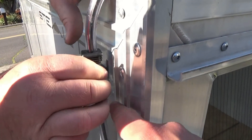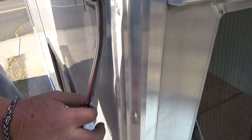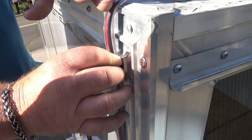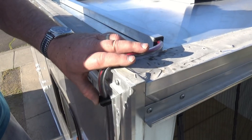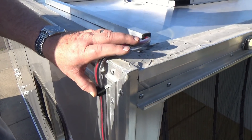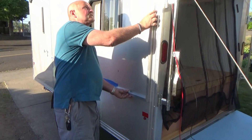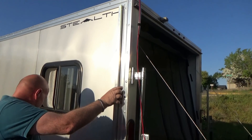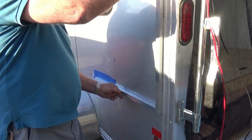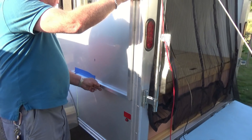On this end I got caps for the tube and put the wire in clear tubing — because of the hump here and the trim piece it wouldn't rise up and make the bend — so this is how I'm going to cap it off. Run that tubing in your aluminum chase, five or six inches. It makes a nice clean water-resistant installation. On the tube going down the side, I drilled a couple of weep holes just in case we get water in there. This is the wire chase coming down the side, and we'll drill the hole here and put the grommet in to protect the wire going into the camper.